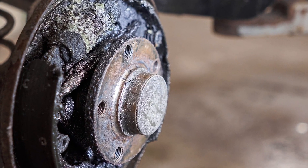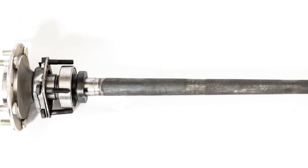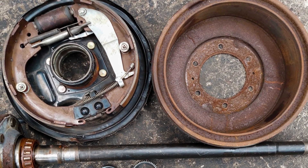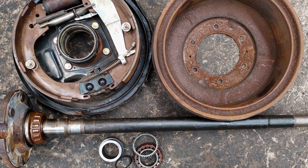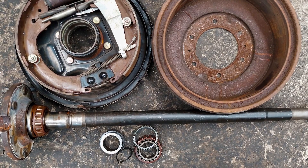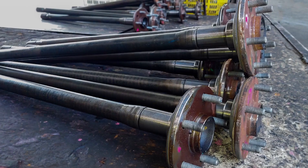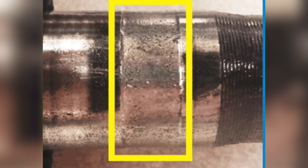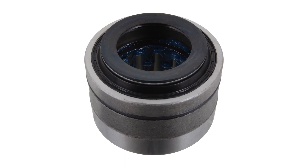The axle shafts need to be inspected. The surfaces on the shaft that make contact with the seals and bearings need to be pristine if the axle is going to be leak-free and quiet. The most critical part of the disassembly is removing the bearings and retainers from the shaft without damaging the axle shaft or housing. Any damage to the surfaces that the seal or bearing rides on can cause premature failure of the new bearing. If the surface is grooved or damaged, the axle can be repaired with a sleeve on some applications; if not, the axle should be replaced.